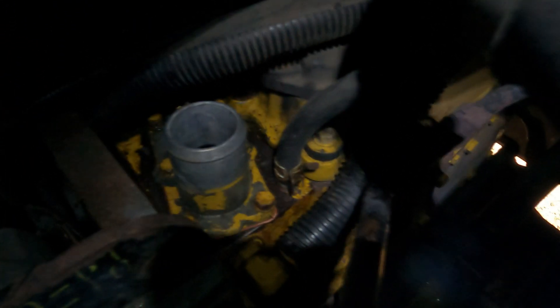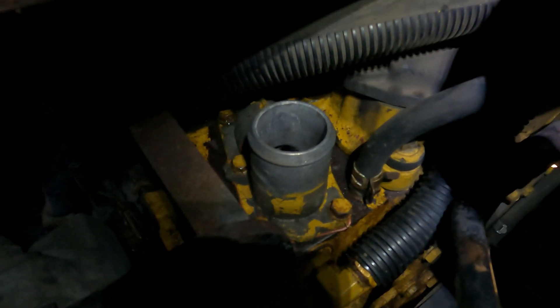You can see we've got the six bolts back in and everything's tightened back down. We've got her all cleaned up, new gasket on, new thermostats in, and we're ready to reassemble. This video is really just about how to put the thermostats in — they're pretty easy, so I wanted to leave out the obvious steps. Now we'll go ahead and reconnect the hose. Before we do that, we're going to fill the thermostat housing all the way up to the top, just to eliminate any air issues. We don't want any air pockets. We also filled it up below the thermostats, so make sure you do that, then put the upper hose on and fill up the overflow reservoir.